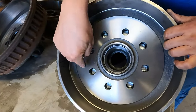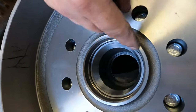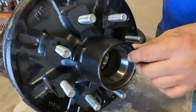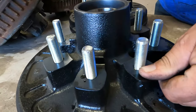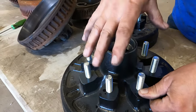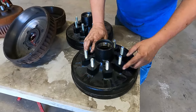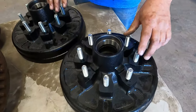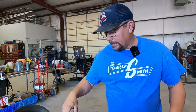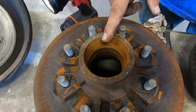Rarely you'll see cracking clearly because the magnet area is so worn it's hard to visibly see a crack in there. Look especially where the seal goes in — if somebody has lost a bearing and that seal is not tight in there, just replace that, same as we said for the dust cap. And always look at this: if your wheel gets loose and you've lost all eight studs and you come to me saying you need eight wheel studs, I'm going to tell you there's a 100% chance you're going to need a drum. It's worn out the surface there, and even a little rounding here — when you stick the new wheel on and tighten it down, that thing is going to come loose again; it will never hold proper torque.